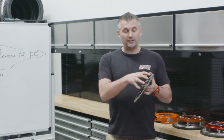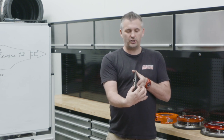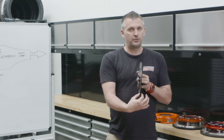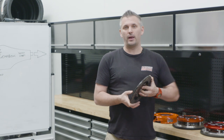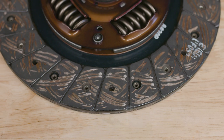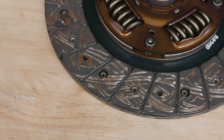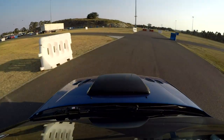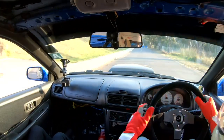What happens if it gets hot? Well, it slips. You're trying to sandwich either side of it, and if that friction material can't get enough friction to hold, it will just slip between the pressure plate and the flywheel. Revs go up, car doesn't go anywhere — the worst enemy of performance: clutch slip. These are great for a factory car or a slight upgrade. For example, we have a performance organic full face clutch in our WRX. We have it sprung so that when we launch it, we don't break the drivetrain as easily. As power goes up though, that friction material isn't going to work.